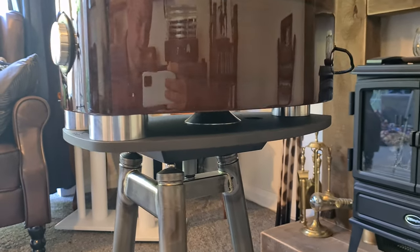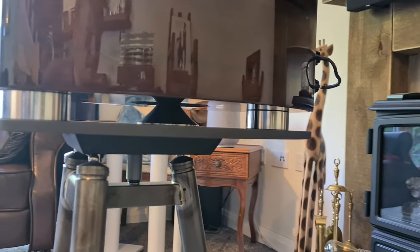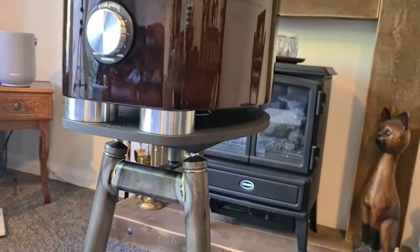As you can see, they're a larger stand-mount speaker, due to everything going on inside. It's got a solid aluminium plinth at the bottom with beautiful aluminium legs which raise it an inch and a half so the bass reflex system can do its job. It's got a down-firing bass port which spreads sound 360 degrees around. They're not rear-ported, so you don't get any boom or bloat — they just disperse the bass beautifully out of the bottom.